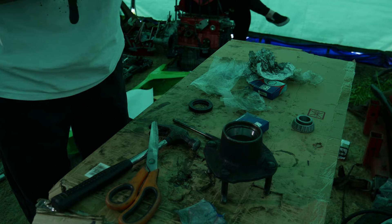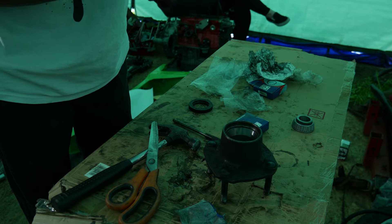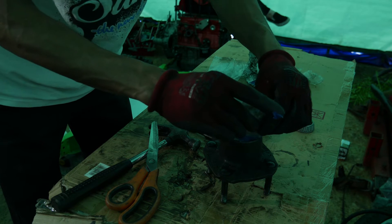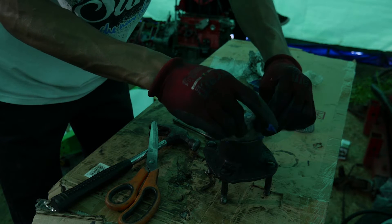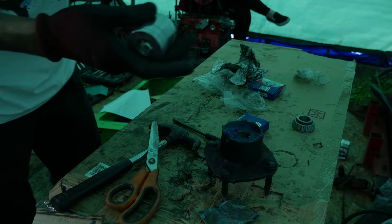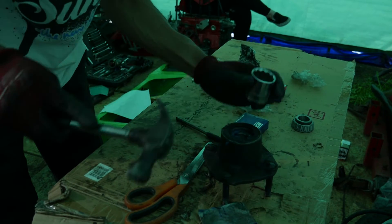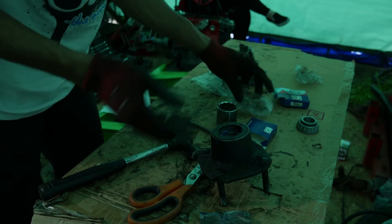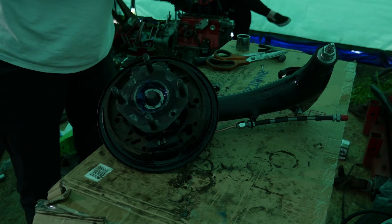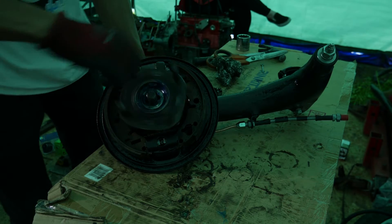Put it around here a bit and give your bearings a roll in there to start them off, then drop it in. The more grease you get in there the better it's primed for when you start using the car — don't be afraid to use all of it. Then so you don't damage it I'll use the socket. The bearings don't sit completely flush — there's a ridge inside where the bush pushes up to and then stops. Spread the grease around if you've knocked it out, because the bearing is loose on the front. Get a few good rotations to help it out.